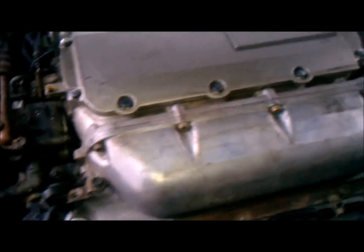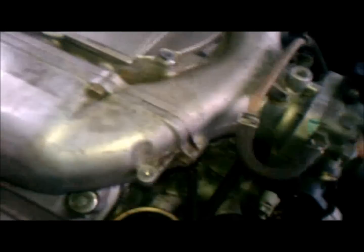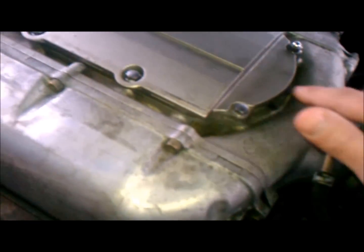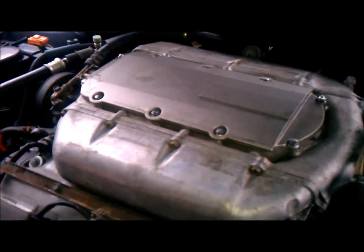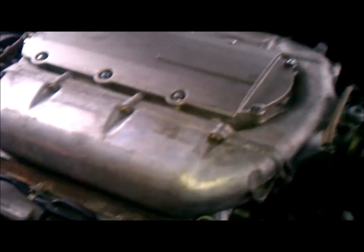These are 10 millimeter again. The best thing to do — it actually has Acura technician tech pages about it — make sure your gasket is done right. You should see two tabs sticking out. If you don't see them sticking out you're going to have to order another gasket. There are technical bulletins about this because they are commonly taken off by mechanics and sometimes put back on upside down, which means you'll need to replace it.